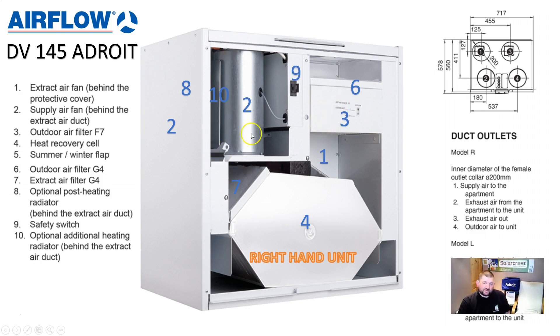We've got two fans in here as well — a supply fan and an extract fan. The machine manages the humidity automatically, which is really good and gives peace of mind. Up there there's what I call a pressure switch. Sometimes this can cause problems — the door has got a little peg on it which must align with that pressure sensor, and if it doesn't, the unit won't start. I remember a few times scratching my head until I figured that in transit it got bent — it was slightly misaligned, and once I straightened it, it started working again. So that's something to check.